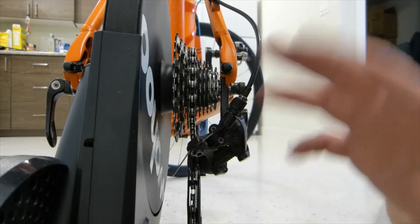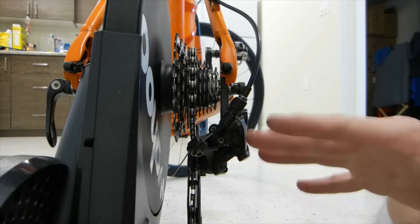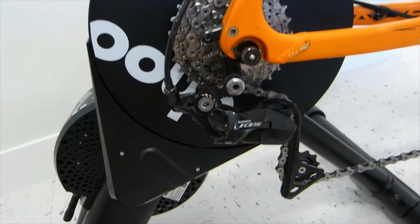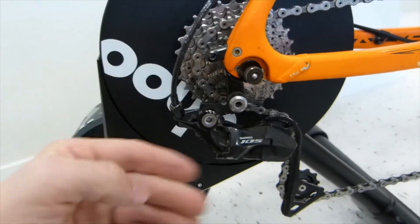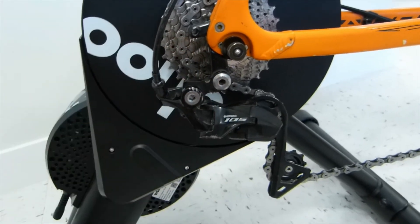That's one part of the geometry that the cable tension adjustment with this adjustment barrel will not resolve alone. And actually, before any other adjustments are done on it, the derailleur hanger has to be straight, and vertical alignment is necessary. That's my story about the geometry on this bicycle. And even though this is a Shimano 105, the geometric principles apply across multiple makes and models of derailleurs. How your make and model actually mounts, where the adjustment barrel is on it, and how the cable tension adjusts — you're going to have to look it up in your manufacturer's technical specifications about your specific model of derailleur. But the geometric principle of vertical alignment is universal.